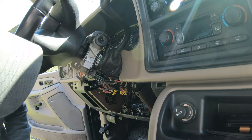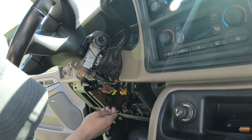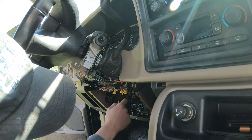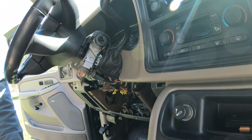Now we can put everything back together — that's pretty much it. It's really not that bad, just basic getting to stuff. I cut out an aftermarket alarm, and I may zip tie some wires and tape a few things to clean up their mess, but overall it's a successful repair. So that's how you change the ignition switch and make sure you get it timed correctly so your key works. If you had that theft deterrent problem, this is the fix. If you enjoyed this, subscribe and watch some more videos — thanks for watching.